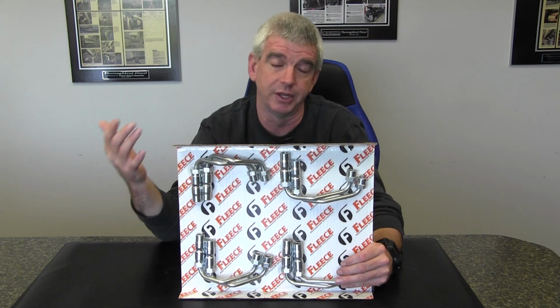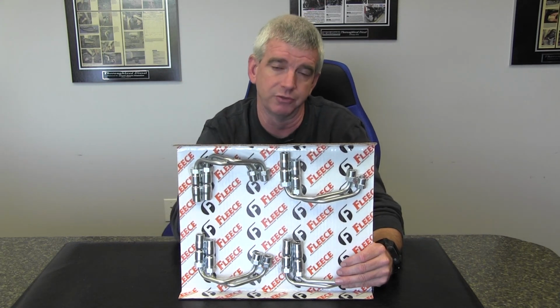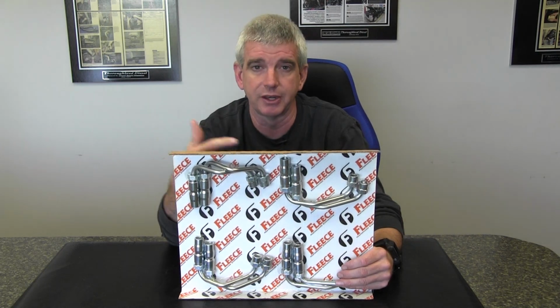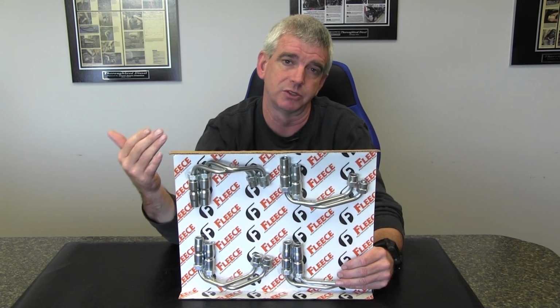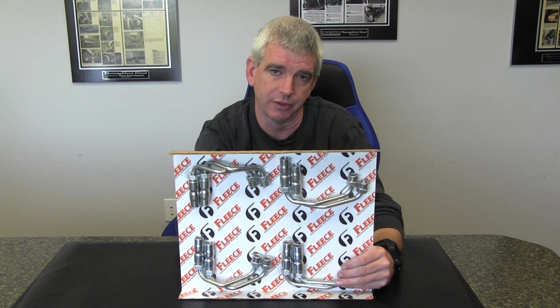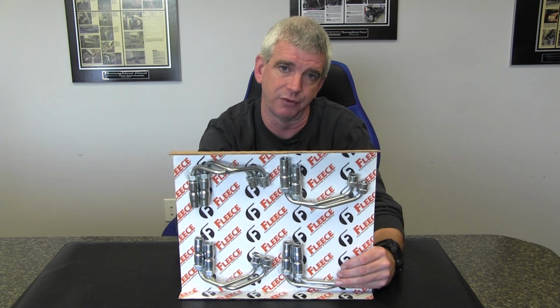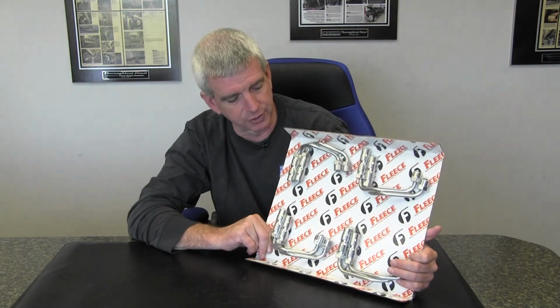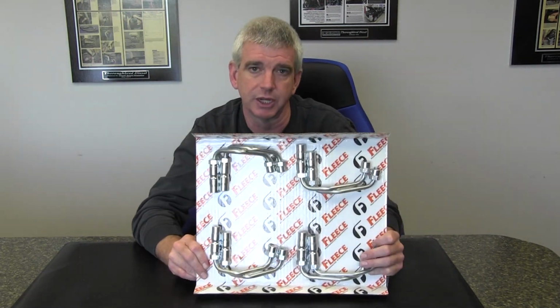Now, another thing that goes on with your fuel injection lines on the LB7 trucks is when you actually loosen up the fuel injection line that passes through the valve cover to the injectors underneath the valve cover. When you loosen up that nut, the corrosion that is allowed to escape past the nut down the fuel injection line will actually wind up at the inlet of the edge filter of the fuel injector themselves.